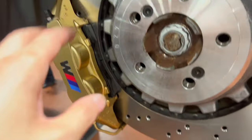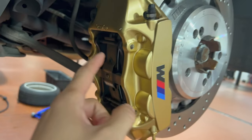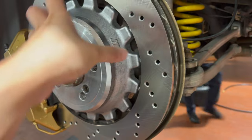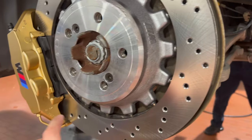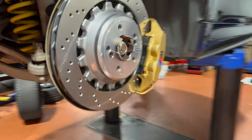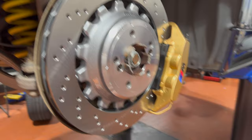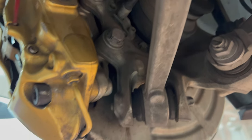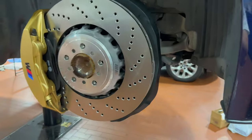So we got the backs done real quick — swapped everything just like the front. These are a little bit easier. You can pop the Jesus clip out like so, this comes out. Make sure your e-brake is off because the e-brake is clamped on the rear. Looks like I have a little damage from shipping — that's fine. These right here are slightly different, so whenever you're trying to replace them, make sure you buy the right ones. Spray that down. Same as the front's 110 newton meters. Brand new, shiny — completely different than carbon ceramics, but they look good.